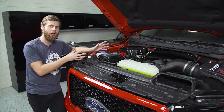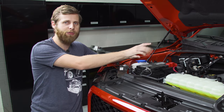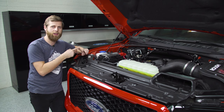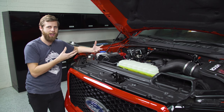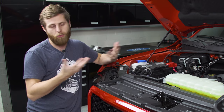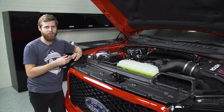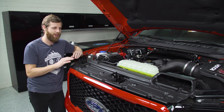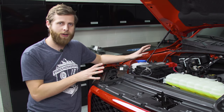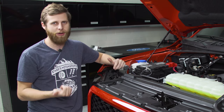The Rigid harness will get the job done. From there, the only things left are mounting your switches in the dash, and getting some connectors so you can connect the lights to the harness. The way Rigid provides it, the harness still doesn't have plastic connectors that click and attach or weather-sealed connectors — you'd have to solder or crimp the lights together, which isn't a clean way to do it. With all the wiring done, now let's look at how to put the brackets on the Rigid lights, since they don't explain that either.